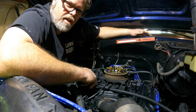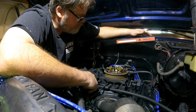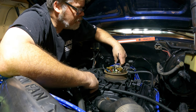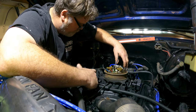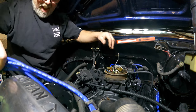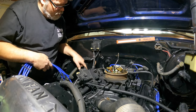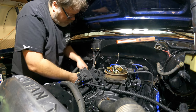What do you think? Do you think it looks fancy? I don't. I had a misfire on number seven still with new spark plugs in there. So I ended up getting myself a new distributor cap, new rotor, cleaned up the wires and checked them - everything seems good on the wires. So now I'm basically in the middle of putting the other wires back in on this side, which are never fun because there's not a hell of a lot of room in here to get your hand in behind all this stuff.